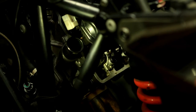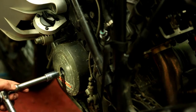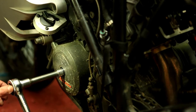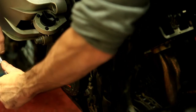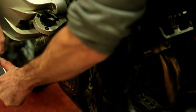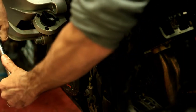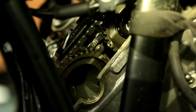We're going to check the valve clearance on the rear cylinder first. Remove the screw from the alternator cover, pull a 15mm socket, and line up the engine at top dead center by rotating the crankshaft counterclockwise until you see the two marks on the other side lining up just above the line of the cylinder head. Then check your valve clearance on both the exhaust side and the intake side on the rear cylinder.